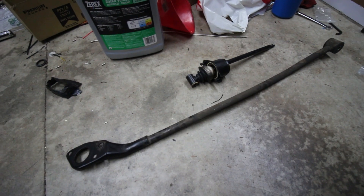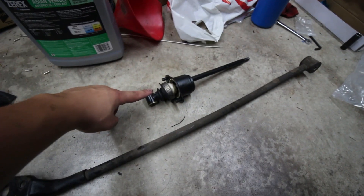A few pieces of information on the actual install: drop the cat out — two bolts, two nuts, super easy — and then a heat shield that is five 10 mils, four holding it up and one in the back. Pop all of those off and you expose everything. Now there is what's called a balance shaft and a shift shaft. Disconnect the shift shaft, then disconnect the balance shaft from both the shifter and up near the front near the trans. There's a nut up there, it can slide off, then slide it out of your actual shift column completely — you need it fully out to get the shifter out of the hole. It'll pop right out at a certain angle.